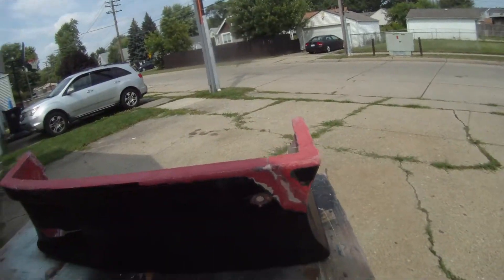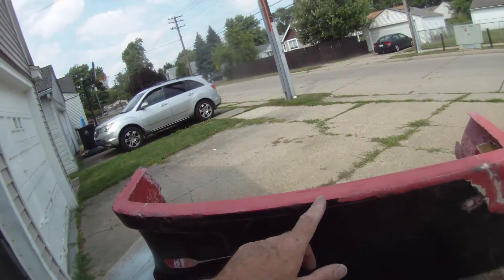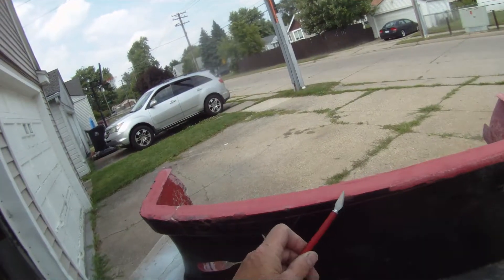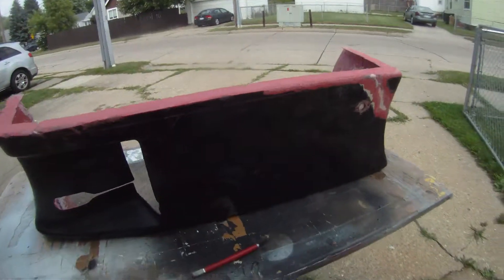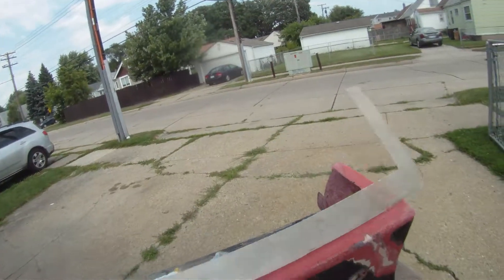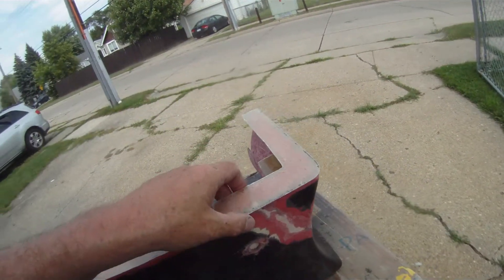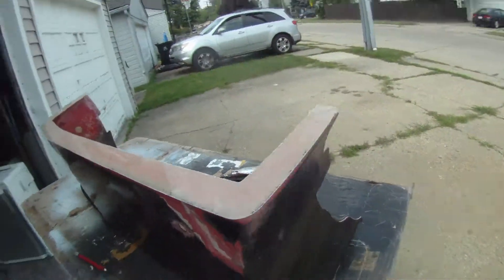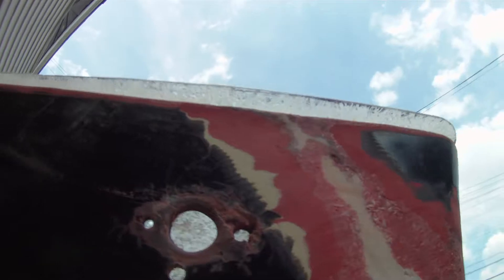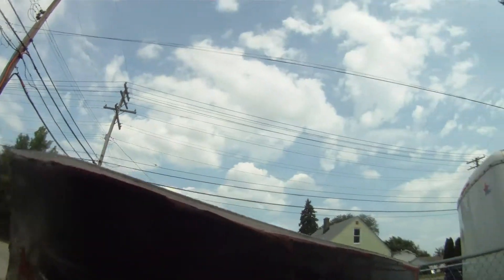Make your own filler if you can, unless it's just little pinholes you want to fill — like spot putty type stuff. We'll go ahead and chip away at this stuff and find out where the loose bits end. I'm going to go ahead and take the piece that I cut from the stuff we laid up on the window glass. We mark this out first before we start grinding on this outside edge, from experience, and we'll fit it to the inside. We left it long so it'll hang over, and we'll use that as a filling tray and refill this whole radius here of glass with the bonding agent we're going to use to glue this piece on.